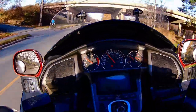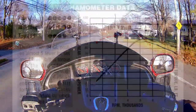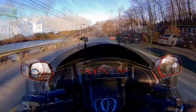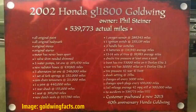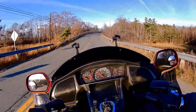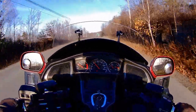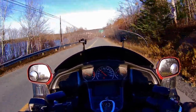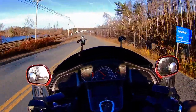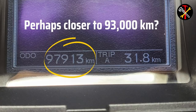Whether these bikes should have had a sixth gear is a hotly debated topic, but I have no complaints about the gear ratios, because fewer gears and a very flat torque curve mean less shifting on slower roads. This engine seems perfectly happy at highway speeds, and Goldwings are known for covering hundreds of thousands of kilometers with almost bulletproof reliability. I would still probably appreciate taller gearing if most of my riding was on highways. The speedometer reads faster than a GPS by at least 5%, which seems to be the case for most Honda motorcycles, and I assume that means the odometer also reads higher than actual.